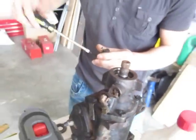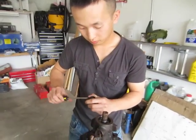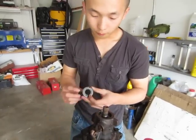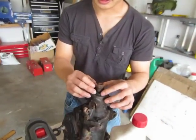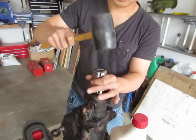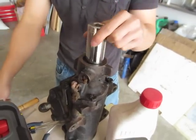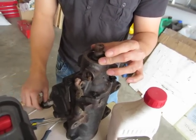I'm going to show you how I would install it with the old one first as a demo. You're going to put transmission fluid on the seal, put it in here, then use the socket, put it in, and hammer it so it goes all the way in. It should stop where the surface is. The reason you want a socket that fits through is so it gets an even amount of force applied on the seal, so it won't go in at a cockeyed angle.